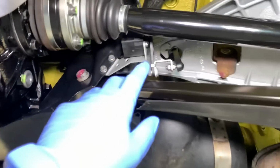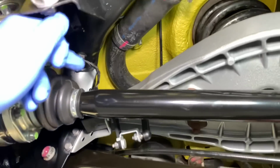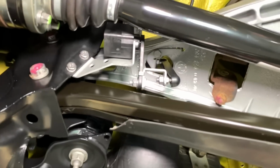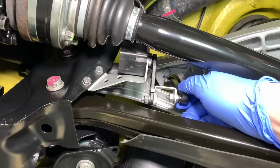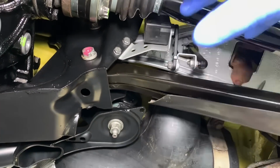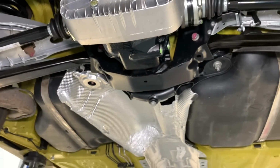We've gone for a new xenon level system, which is the potentiometer, the brackets, the bolts, a new wiring plug on that end because the tabs normally break off, the new hockey stick brackets and the bracket up there that goes on the top arm, and obviously the drop link, which now articulates wonderfully. That ball and socket motion is going to be able to relay the suspension loadings to the potentiometer and therefore to the headlight leveling system to make sure that's as accurate as possible.